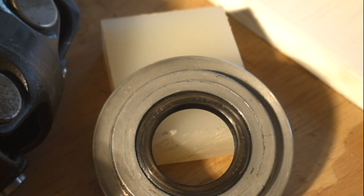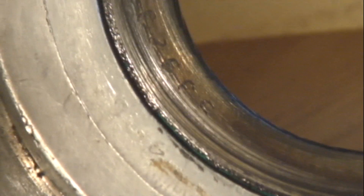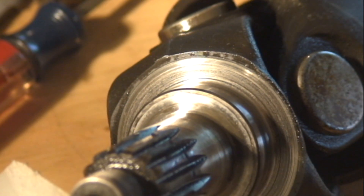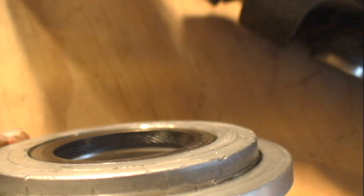Here is the driveshaft seal and seal carrier. It's important to find out why the seal failed. Here I can see that this seal is all scored on its face, and this face on the yoke is all scored up as well. That seal seems to have shifted inside the carrier and rubbed on this yoke. A new seal simply needs to be installed on this carrier squarely and positioned between the two chamfered edges of this inside diameter.